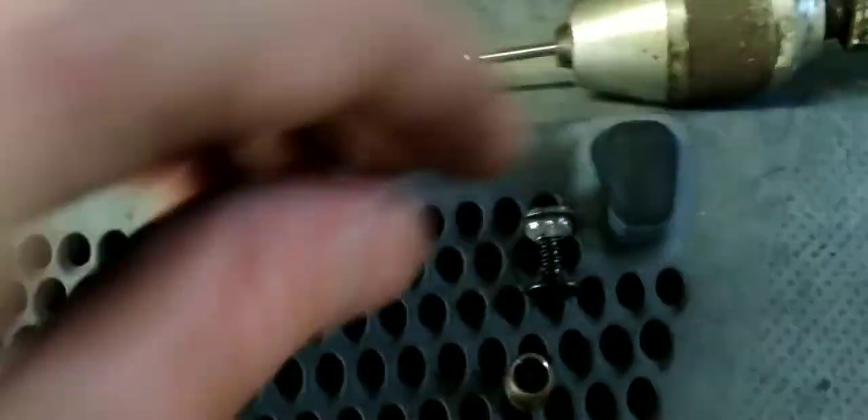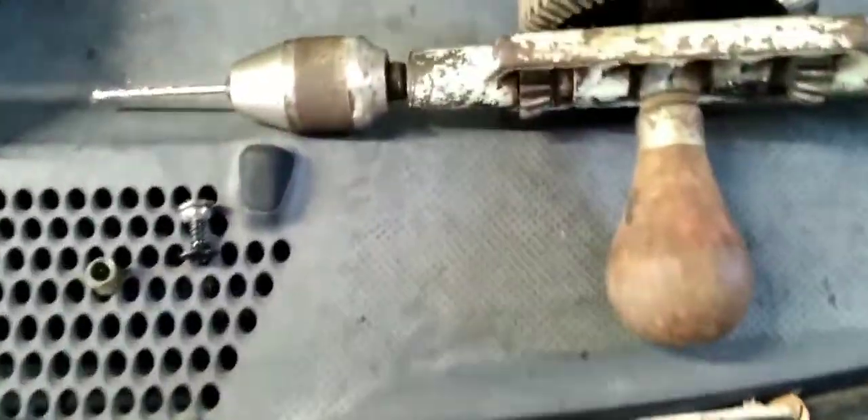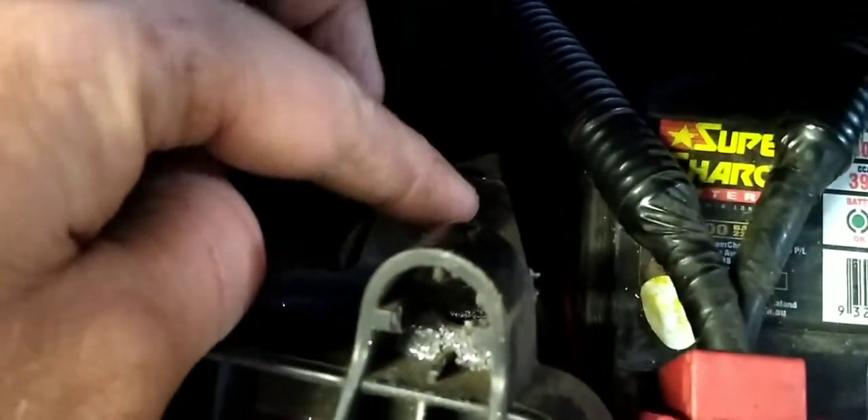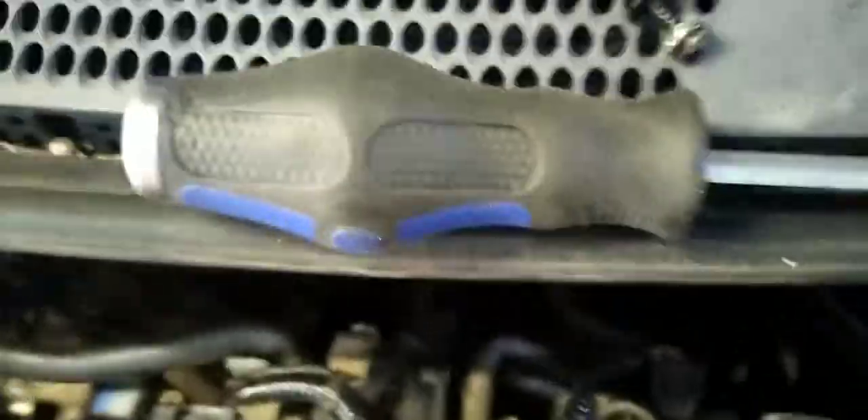I've had to actually get a drill piece. There's the helicoil bit — that will go back in the top of this in a minute because I haven't destroyed it at all. I first tried to get it out, I couldn't, so I drilled it by hand with the old hand drill because you can feel it better and you're not going to damage it. I like these for this sort of work purely because you have a lot more control than a drill going too quickly and you won't go off center. I drilled here and that's the rest of the screw there. I drilled a hole then got a little self-tapping mushroom head screw, screwed it in a bit, and it got stuck in there — managed to get it out. So just a little tip: drill it out first in the center, then get a little mushroom head self-tapping screw, screw into it clockwise and then anti-clockwise, and the rest of the broken screw will come out.